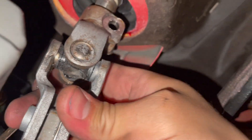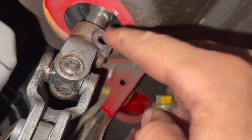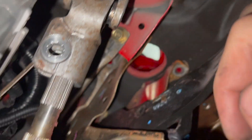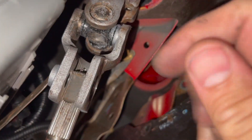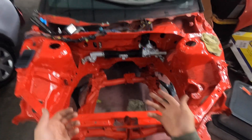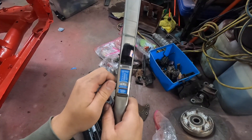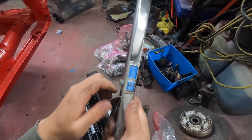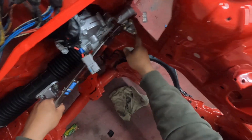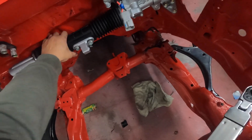Now that everything is all set, we can lock it in. Make sure you have the spline on this side nice and flat so you can stick the screw in. The first bolt you want to put in is on this side because this side has that groove. Make sure you can slide this in. You see how you got massive play right there — this can go in second. So there it is — the rack is all set in there. This thing is starting to look like something now, guys. Setting this to 46 foot pounds — lock that in. I'll try and do it without an extension because that kind of changes the torque. If you guys have an answer for the torque spec on this, let me know. But yeah, these are all tight now — this ain't going nowhere.